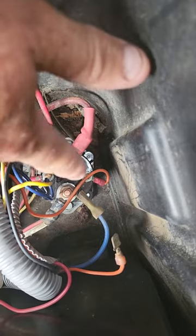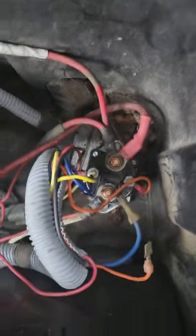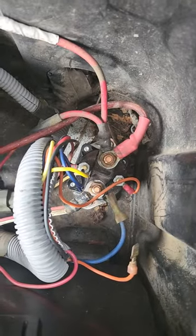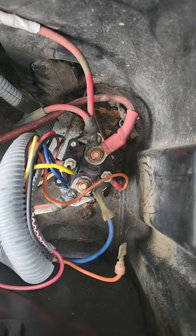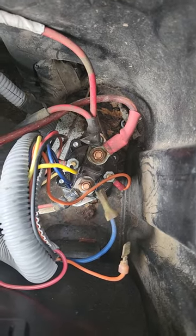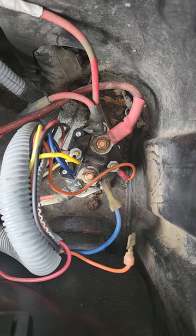See this right here? The orange wire — I'll tell you where that runs to. But you've got to be able to say, where does that run to? Underneath there. Right now, we're just talking about the solenoid. The solenoid itself provides power over to the starter generator, and without that working properly, everybody on all the YouTube videos tells you you've got to get that replaced. A couple of mechanics I know just love replacing these, but what we're going to do is test them first.